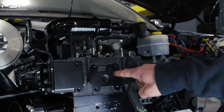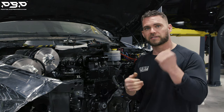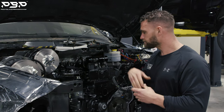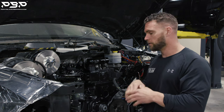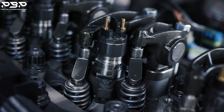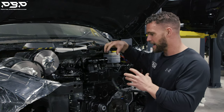Who's making the cylinder head? Miller's Machine Shop. We've trusted these guys over seven years of making all of our cylinder heads. This is a one millimeter over factory size intake and exhaust valve — 35 millimeter to be exact — so we can flow some big power. Now it's a 5.9 liter setup; on a 6.7 liter they'd be two millimeters over, but on this engine — now actually a 5.9 setup — we have a one millimeter over. For hardware, we have 14 millimeter studs from Wagler Competition to keep this head seated down, along with fire rings that seat in the cylinder head and fire rings that seat in the actual engine block.